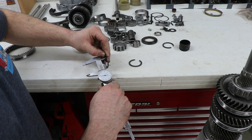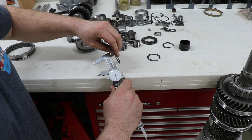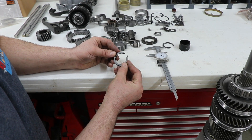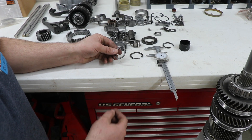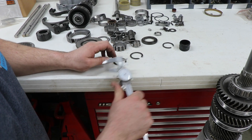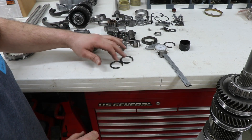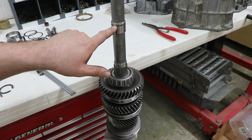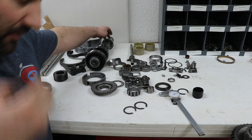Then with measuring the other ones, I'm going across the center diameter and I have 1.360 and 1.330. I do believe the 1.360 is slightly bent out of shape - at least it looks like it is, and it also has a little bit larger OD on the diameter, so that'll come in to determine which one goes where. The ring that's already assembled on third gear measured 1.440 across the inside, and the shaft there is 1.400. One will be on the main shaft for the speedo gear, and the other one will be on the back of the secondary shaft holding fifth gear.